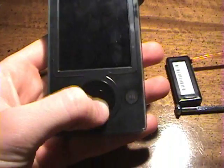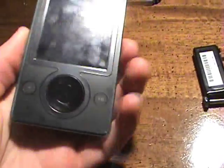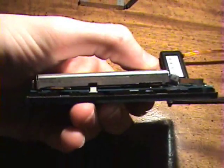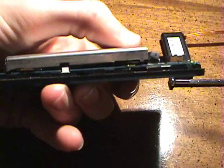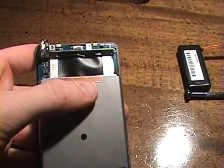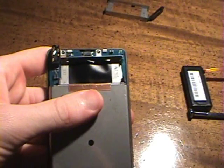Looks dirty now, but it's not really. I already did this — they all clicked, everything's good. Buttons were done correctly. Now, this is a 60 gig hard drive, so there's a little give there. It is meant for a 30 gig, so putting in a 60 gig takes up more room and it's going to be tighter, but it should work — should fit, should be fine. I'm going to go ahead and install the battery, then put on the back panel, and then we'll be done. And you'll have your new 60 gig hard drive.